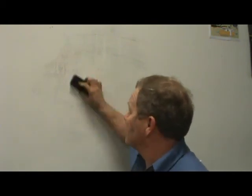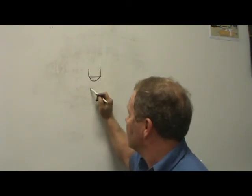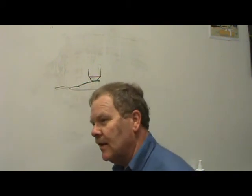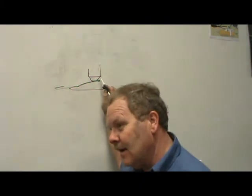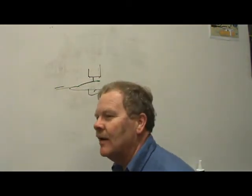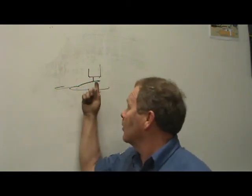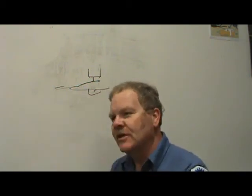And you know, inside the distributor, right in the center of it, you've got a little carbon button. The rotor rides against it, it's got this little tab, and it rides against there and sorts out the spark when it's spinning around. This little carbon button came out of here, and it was rolling around down in this little pocket right down here. So every time her spark jumped, she had a naked lightning bolt right there. And that's where her radio frequency interference was coming from. So when you pull the distributor cap off, if you see that little carbon button rolling around down in there, you're going to have RFI. We put another distributor cap on it, and she's good to go.